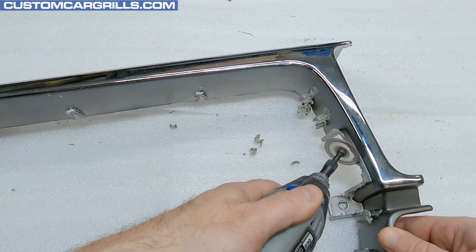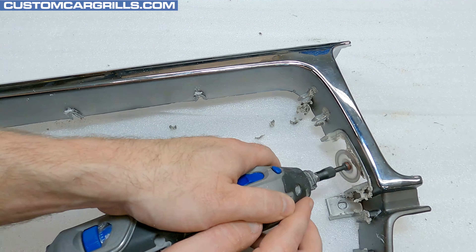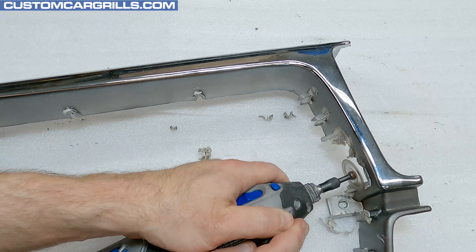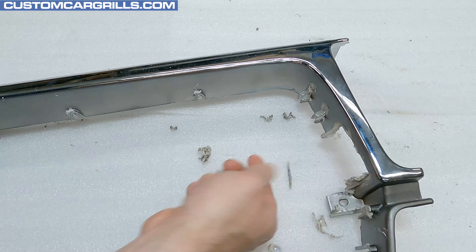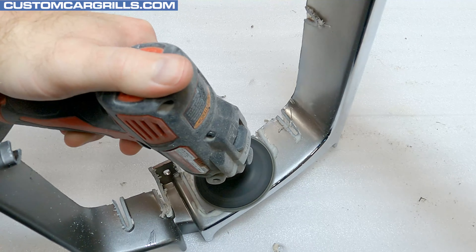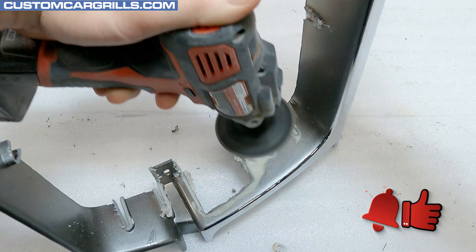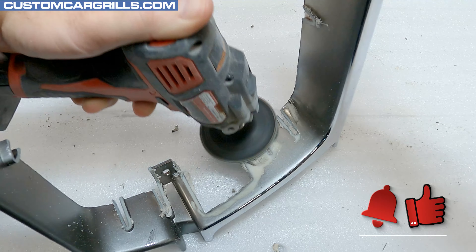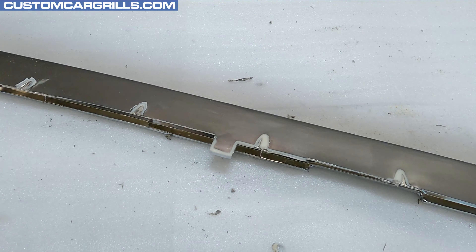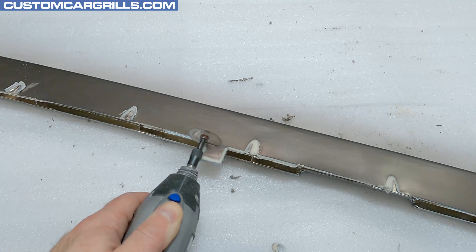This looks pretty rough, so let's start to clean up some of this excess plastic to make trimming of the depth of the grill a little easier. I'll just use the top of the shaping wheel to shave down the remaining plastic that's protruding from the edge — getting this relatively flat without cutting past the edge. Having access to an electric or pneumatic sander can speed this up quite a bit. I made short work of this with some 80 grit sanding discs on a cordless grinder, but it can be done by hand if a tool like this is not available. Afterward, I also cut off the little tab that was on the top edge, making it flush with the rest of the grill.